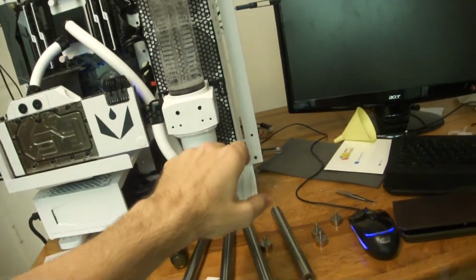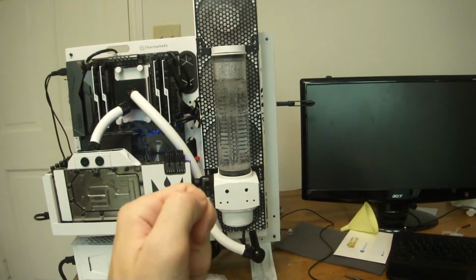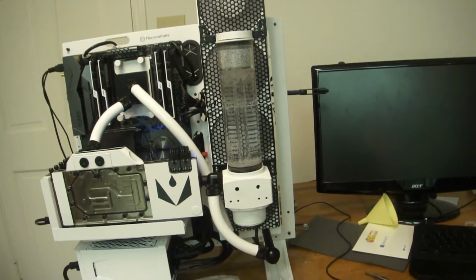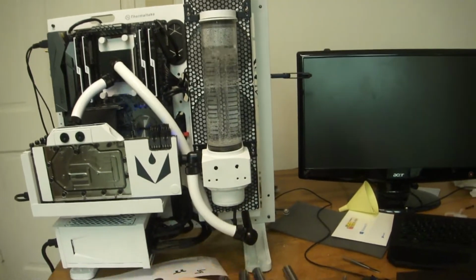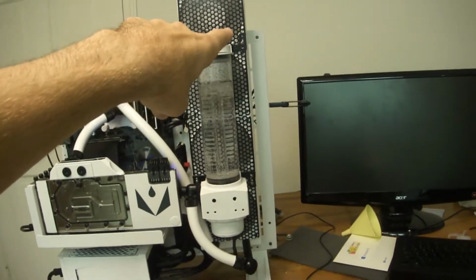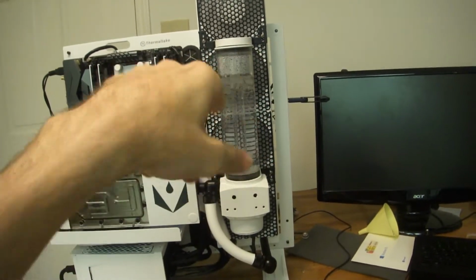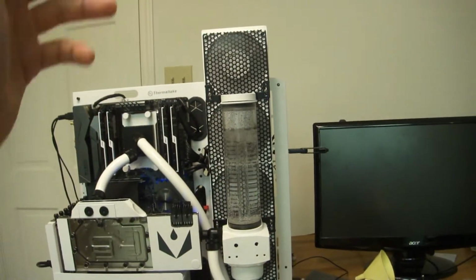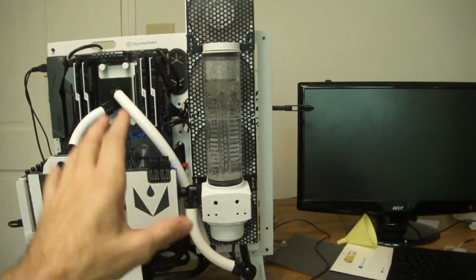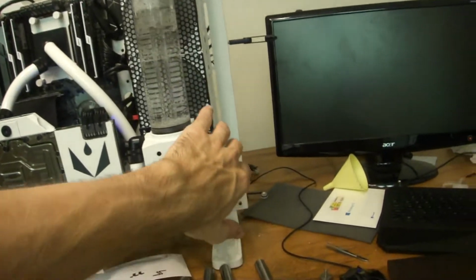If you back up even farther, I had to crack the fans open again and actually clean them out. I just used my nail to chip out the stray paint, the excess paint that got on the interior housing. When I tested these one by one, thanks to Crash, who recommended it, I found out that some of them had excess paint in there that was grinding on every rotation. When it starts spinning as fast as they do, that turns into a whistle, something that's not just air moving. Anyway, I think I did that on 2 of them.